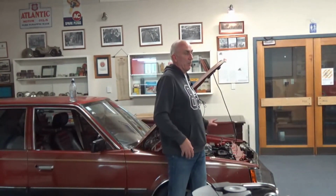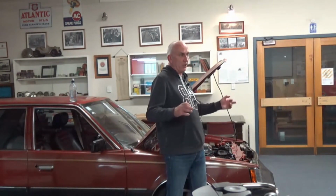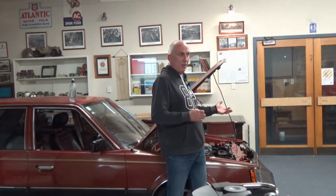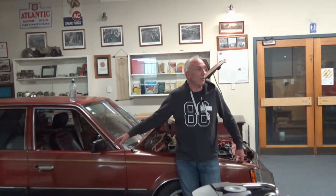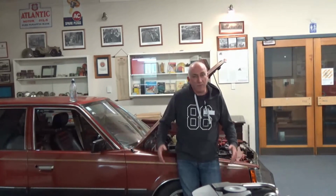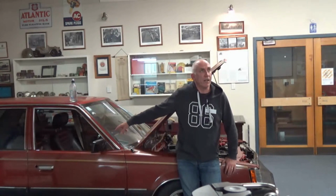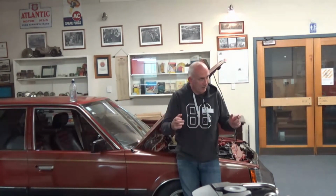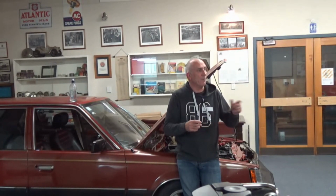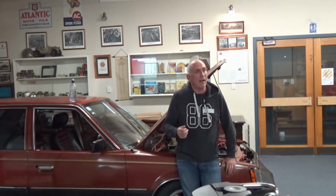And even though the Toyota 6-speed is completely different, the cross member for the superbox basically bolts up to the rubber mount on the 6-speed, albeit only 2 of the holes line up. So this has got a factory Toyota cross member in for the gearbox, not for the gearbox to sit in, but it lines up. Again, there's an issue over whether or not, this would ordinarily have 4 10mm bolts holding the rubber mount to the gearbox. Then that rubber mount's got 4 8mm bolts holding it to the cross member, and the cross member is held to the car by 4 8mm bolts. So obviously the 4 8mm bolts have got less strength than the 4 10mm bolts, but it's only got 2 of them.